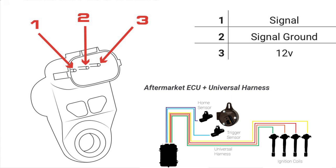As far as wiring, you have three wires. From the rear of the connector with the tab facing up: left is your signal wire, middle is your ground, right is your 12 volts. Look up the ECU pinout for whatever engine management you are using. Connect the trigger signal wire and home signal wire to the appropriate ECU pins. Connect cam sensor grounds to either the trigger and home ground on your ECU or to the chassis. Connect your 12 volts to an ignition source powered by key — make sure it has constant power while cranking.